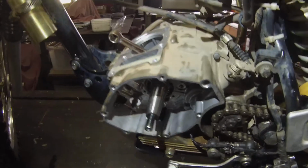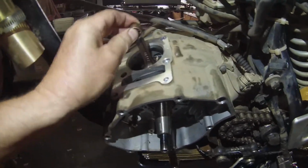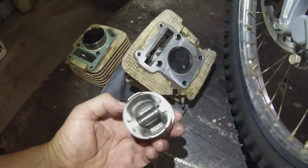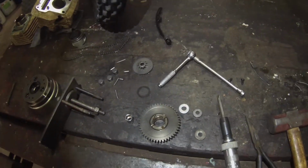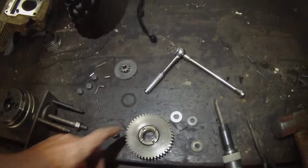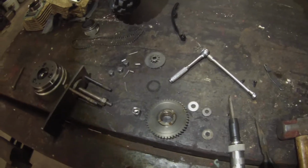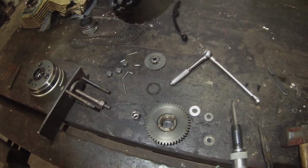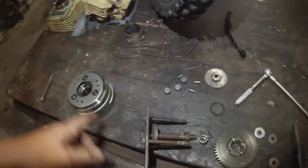But I thought, there's few things that will ever go wrong with these sort of motors. I mean, the little end bearing on these is as solid as, and its big end. There's absolutely no play in it. I took all that off, see it down here, there's nothing wrong with it. Gudgeon pin fine, nothing wrong with any of it. So I thought it's got to be this starter motor clutch system, this one-way clutch system. Somehow it's causing all the rattling noise. And it's quite a significant knocking noise. It wasn't light.